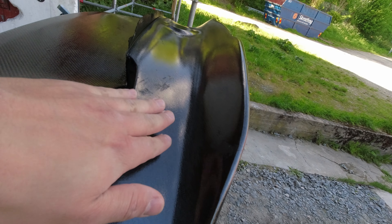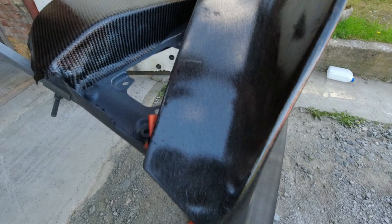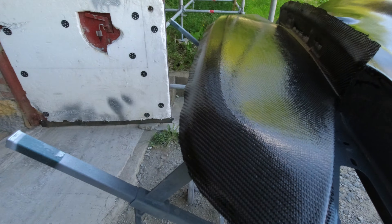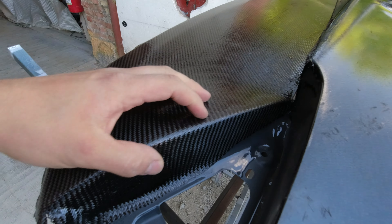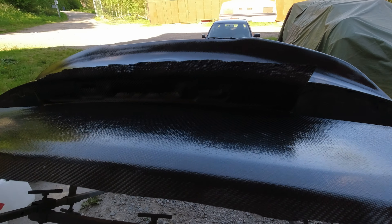It's the next day and as you saw I messed up huge yesterday. When you're doing these intricate radiuses that I have on this ducktail, going over to the other side, I cut the weave too short because it's really really twisting itself from the radius, and then I missed a big chunk here like a decimeter. So I bought some new weave today, a wider one, and hopefully I'm gonna get help this time - this is really hard to lay on yourself.